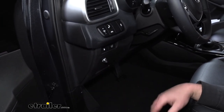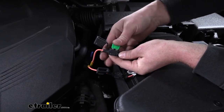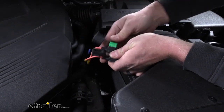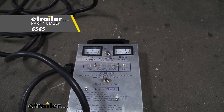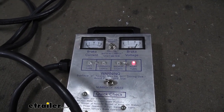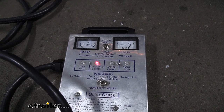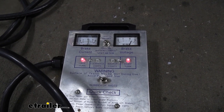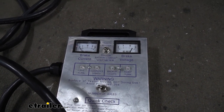Now move under the hood to the fuse holders. Take the included fuses and push those into position — now we should be able to power everything up, test it, and make sure it's working properly. Using a tester box: try the left turn, right turn, brakes, taillights, hit the manual override on the brake controller, and in the top right corner of the tester you should see 12-volt auxiliary power as well.